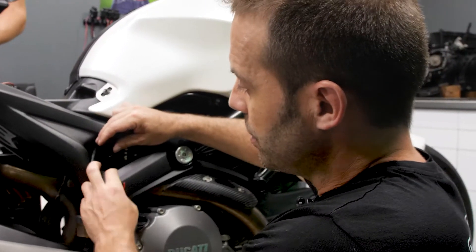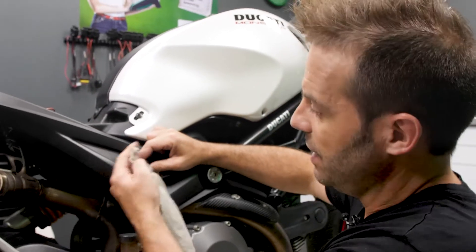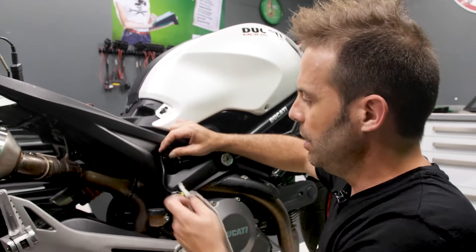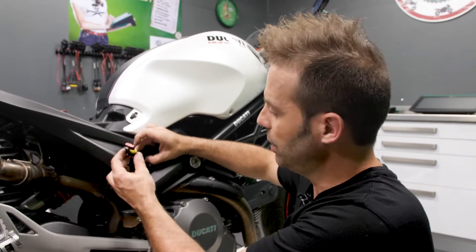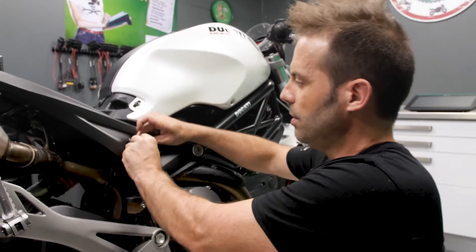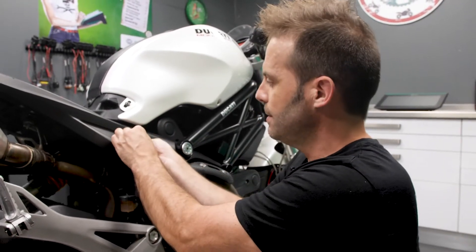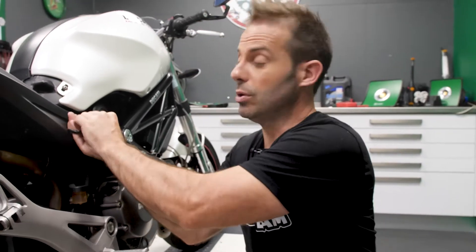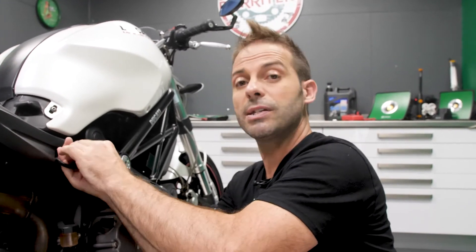So that's sorted out. The connectors might have had a buildup of residue. If you drive in the rain, water can get in everywhere. Also, some people clean their bikes with a high pressure cleaner or even just with a hose. If moisture gets in, it can lead to problems with the probe. On this bike there are two lambda probes — one on the rear cylinder and one at the front. If one of them is faulty, the values for the preparation of the mixture for the cylinder concerned won't be right anymore.